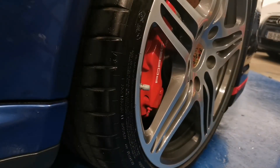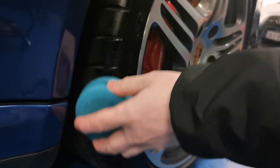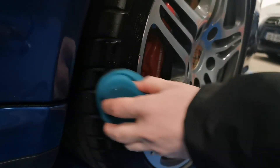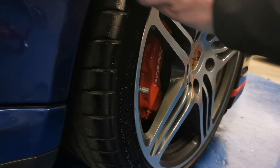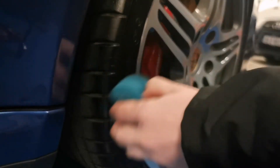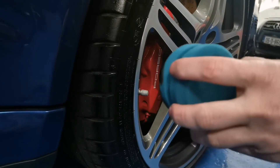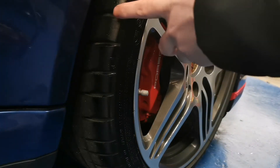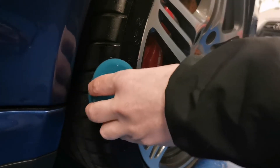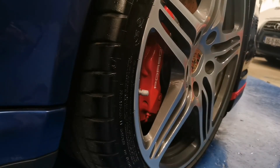So how do you stop this? One handy way is when you're applying the gel, rather than moving the sponge in a direction where those grooves grab the gel and draw it in, apply your dressing in straight lines in the same direction as the grooves. That stops the build-up in the grooves themselves. It'll take a little bit longer, but it's going to stop the sling. If you do end up with a build-up in the grooves, use the edge of the sponge in each groove around the tyre to remove the excess.